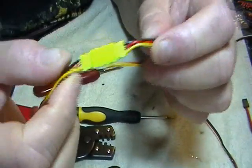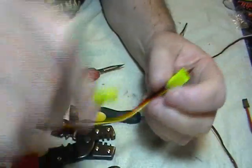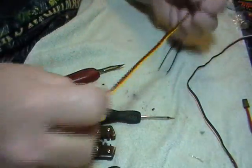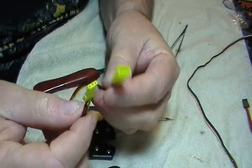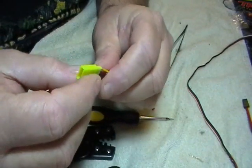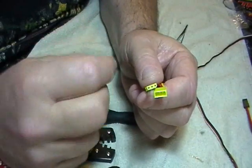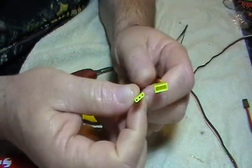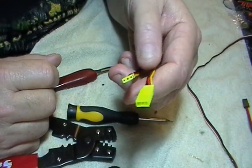When you plug the two ends together, the wires all match — that's the main thing. Make sure you get your color code in the right direction; if you get it backwards, the polarity will be wrong and it won't work. The most important thing is to make sure you crimp that first set of wings over the plastic wire coating to hold it. Hope that helped you out Derek and anyone else interested — that's how easy it is. Thanks for watching!